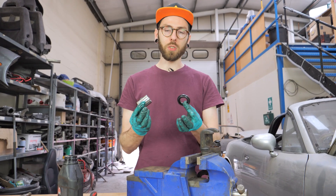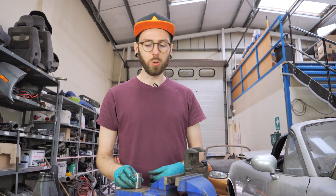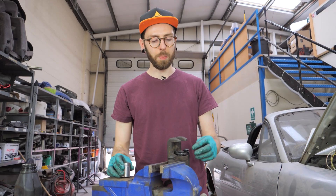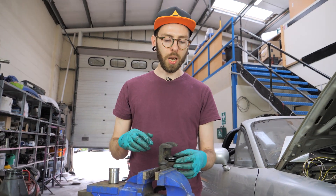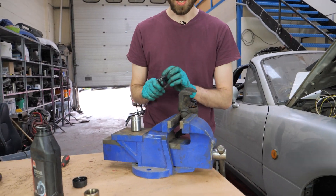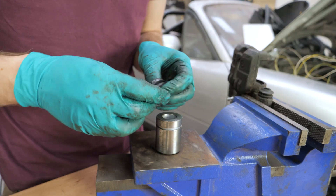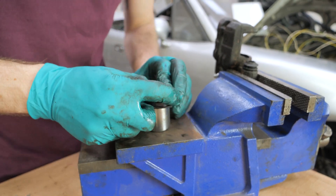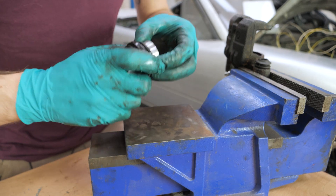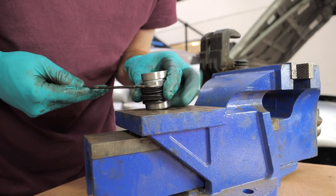So now we're going to do the pistons and the dust boot — this is the part that is definitely the most painful. If you've never done it before, I've tried all sorts of things: putting the dust boot in then using a pick to pull the boot around the piston — extremely hard. Putting the dust boot in and using fingers to pull it apart — also extremely hard. I've found a great technique that should help you get your boots in super quick and easy. This part of the dust boot is going to sit inside the piston — I'm going to put it on and push it past the lip from the top of the piston down.